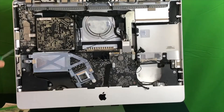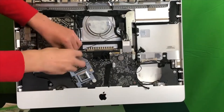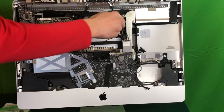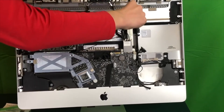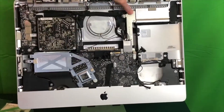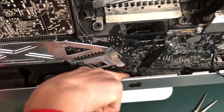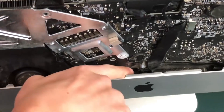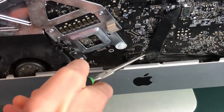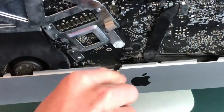You're also going to need to unscrew the screw here on the CPU mount of the iMac, and then the screw up in the top right. Now at the bottom of the iMac, we need to go ahead and remove that piece of tape that is covering up the IR chip. Remove the tape and then pull out the IR chip at the bottom of the iMac.